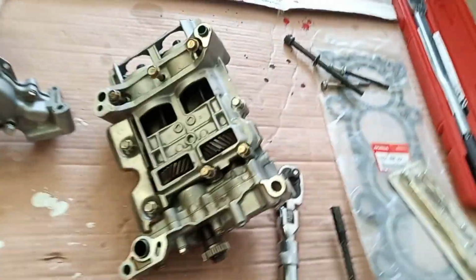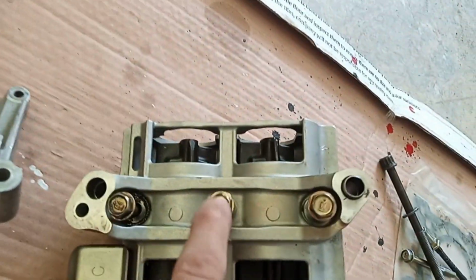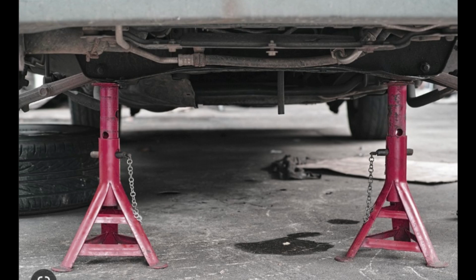Now what we'll do is open the oil pump. I've already loosened the nuts. These require 10 mm and these require 12 mm, so I remove them. We will cut the balance shafts, and then we will open the oil pumps themselves and compare them inside. Removing the oil pump is very easy. Just drop the oil pan and remove the chain tensioner and chain, and the oil pump will be out, with no need to remove any crank pulley or head, etc.